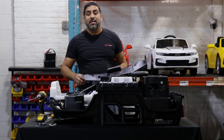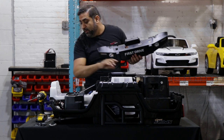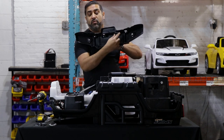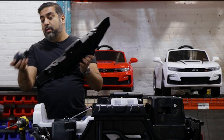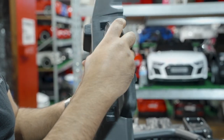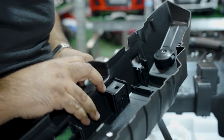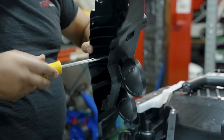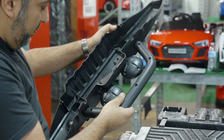Next, we're going to assemble the front bumper. We need this front bumper trim — the mustache, that's what I call it — and the two lights. Behind the bumper you have four screws; we'll start by taking those out. Then we're going to put the light into the front bumper — it's the second hole over. Slide it in, and as you're sliding it in you'll see a screw hole. Make sure the holes line up, then put the screw right back in. We'll fit through that hole, line it up, and place the screw in.